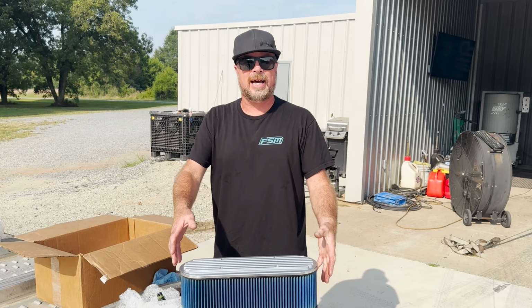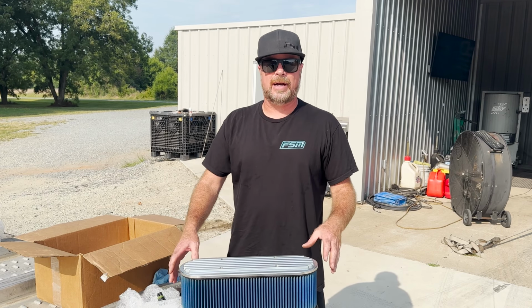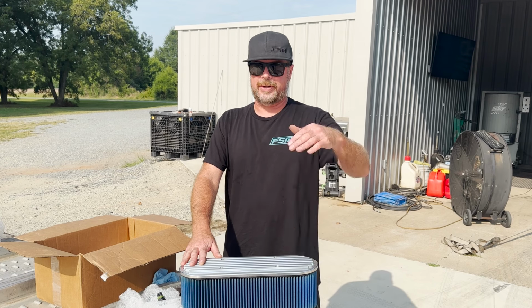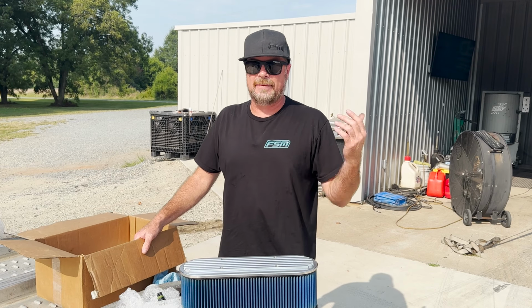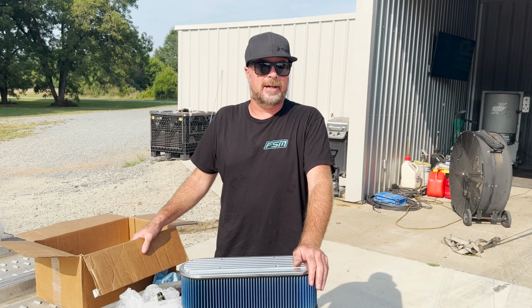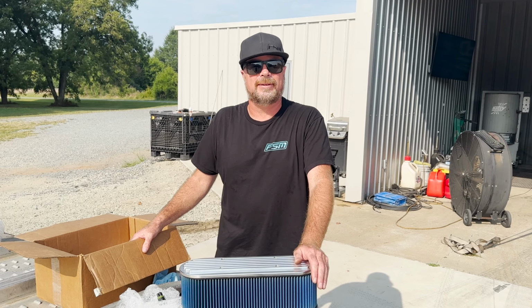This will bolt right on top of my Blower Shop 871. We're gonna have to make some adjustments to the linkage and the wiring to make it work, but this will answer the question. Do I have a restriction on the inlet side, on the outlet side, somewhere between? I don't know. My belief is that a 528 Hemi on E85 should make more than 950 at the tires, and it has before. We just need to figure out a way to make that much again.